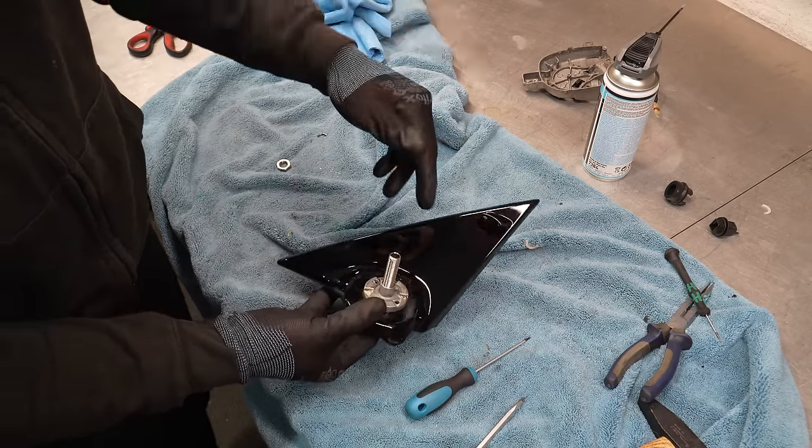You get the idea. I'm going to do it over there in the corner so I don't make a lot of mess on the table. The first round of trimming is done. This can now move freely in the bracket. Now I'm going to shorten the screws, then mount the projector, and then more trimming is needed so that the projector can move freely inside of this assembly. So mount the bracket to the projector with supplied screws.